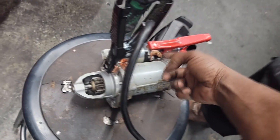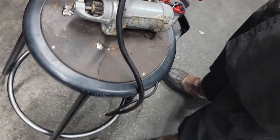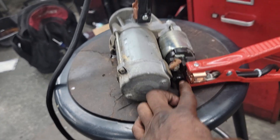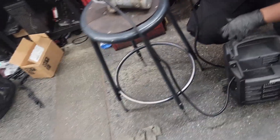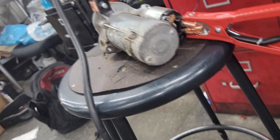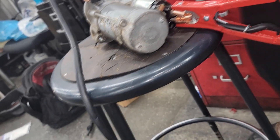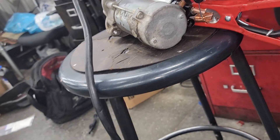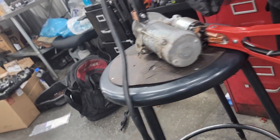So you're gonna find a way to get 12 volts to the solenoid and make it run. How you gonna do that? You can use a screwdriver, but the connector is surrounded by this housing. That's how we did it back in the day — used a screwdriver to make that connection. So I put the wire right here between the clamp where it actually bites and makes contact, just for 12 volts purposes. Then I bent the wire enough to where it actually makes contact with the solenoid, and then grounded it.